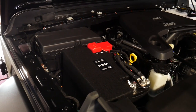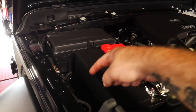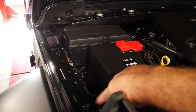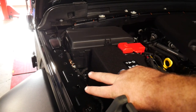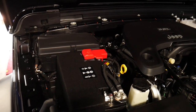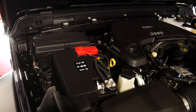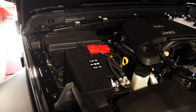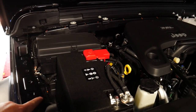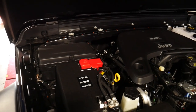For all of you who want to use those auxiliary buttons inside the vehicle, Chrysler made it super simple. Right down here in the harness is a taped-back connector with four wires: two smaller around 20-gauge and two larger around 14-16 gauge wire — two different amperage outputs for two different styles. If you want to put a winch on it, use the bigger amperage ones; for small LED light cubes, use the smaller ones. These are activation wires — they put up 12 volts from all four wires when selected on the dash.